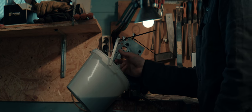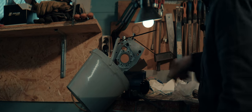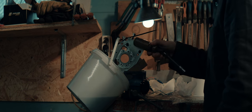The exhaust port bridge is bulging a bit. That will interfere with the hone. I'll relieve it a little bit now before honing, and I'm going to relieve it more after honing.